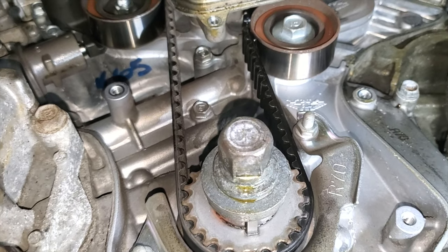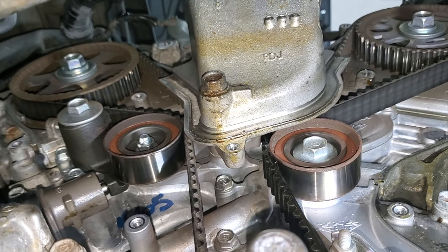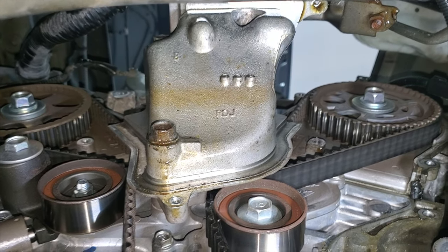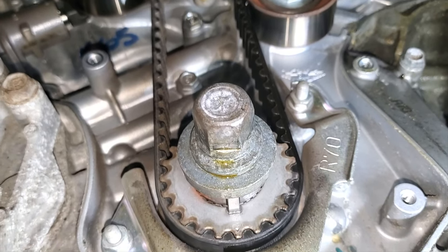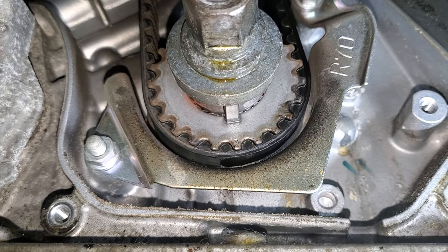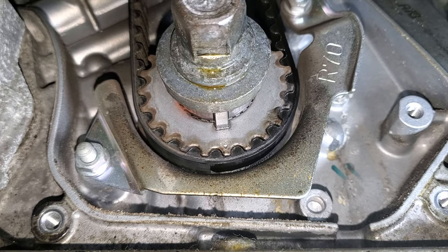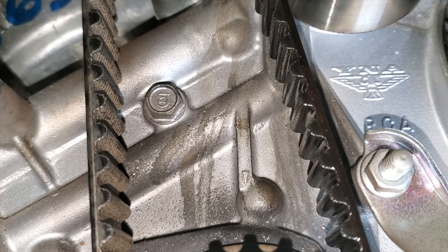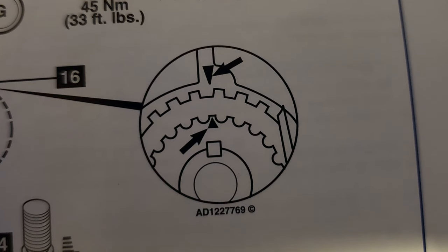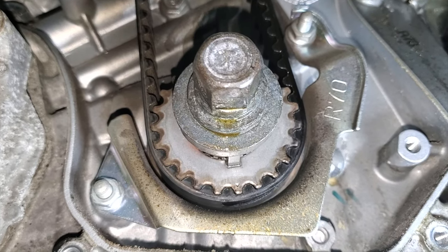At this point, here's the belt we need to change, the two idlers, the water pump, and the tensioner. But we have to get that motor mount out of the way. Before I lower this thing back down, I'm going to align the timing mark. If you look at six o'clock on the crank pulley, there is a timing mark. I'm going to align that with the little arrow pointing down on the block by turning it 180 degrees, and then we'll be able to get the old belt off and the new one on.